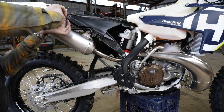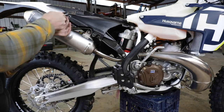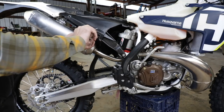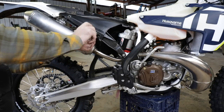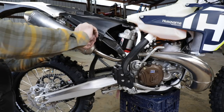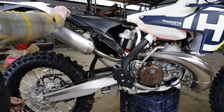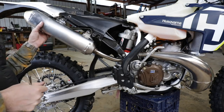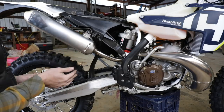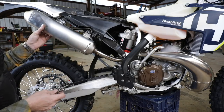I had to buy two torque wrenches — a three-eighths drive which I showed you the other day, and a quarter-inch drive one in inch-pounds for smaller stuff. Some things in the book have very low torque specs — this one is 7 foot-pounds, and the three-eighths drive wouldn't go that low. Years ago I'd throw the manual away thinking I knew everything, but now part of the enjoyment is doing everything properly. The book gives you instructions with pictures, sequences, which bolts to loosen — if you don't do it right you can break things. It gives you all the torque specs, and it gives you peace of mind ripping down the road at 70 mph knowing your front tire is torqued to the right spec.